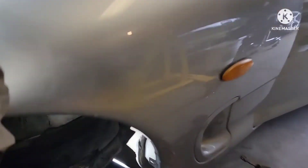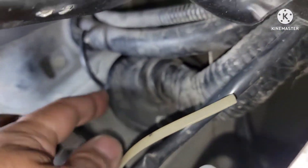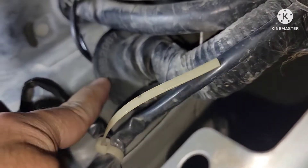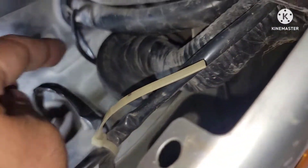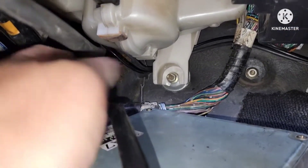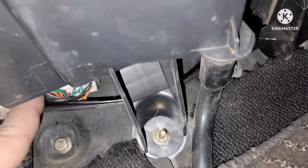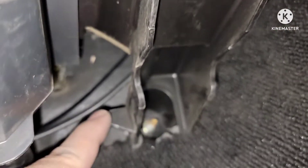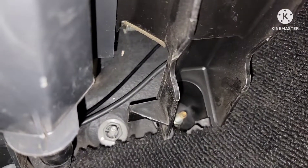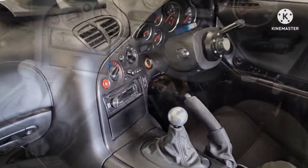On the fender it goes up — there are those two lines right there — it goes into that big wire loom inside. This will push in and close that gap right there. I took out the ECU — it just comes out right here. There's a blower motor that comes out right here. I tucked it in already. That's the line right there. It tucks on these brackets and all these plastic brackets right here so it's not hanging down low. It goes over the tunnel, under the dash.